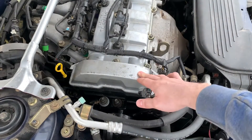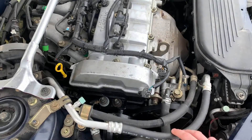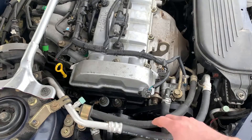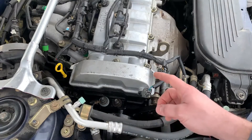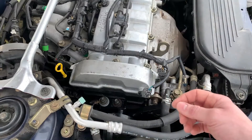While you're back there I would recommend just replacing the shaft seals anyway. If you buy a timing kit for this car they usually come with that, but just look for a kit that has them included. It's also good to replace the water pump while you're back there, and the timing belt tensioner — both of those should come with the timing kit.